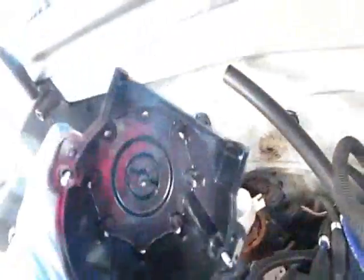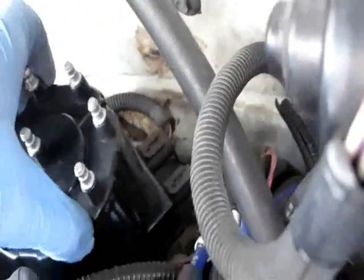When you put your distributor cap on - you can see where I'm working, I'm actually inside the engine bay and there's plenty of room, it's easier this way on this truck. There's a little back piece that has to align with the little crevice in the module. Then just drop it down - make sure you're not pinching anything, the wires or nothing. When it's on correctly, the cap is going to sit over the housing. I don't think it's quite there yet, sometimes you gotta finagle it a little bit.